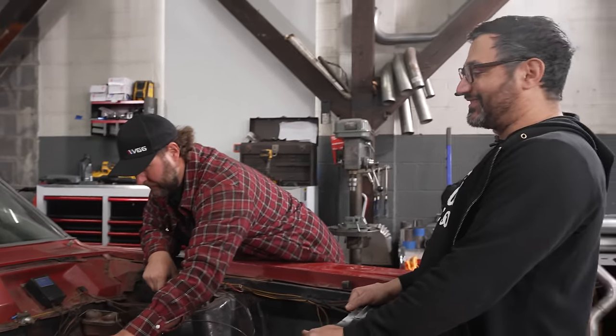Don't do it. Somebody get a tape measure and let's do this thing. This is the 80s, so it's probably jacked up. Yeah. Probably have some heat here. 68 and 3/4 inches. The center of the U-joint, so right on that flange. 60 here. And a quarter. Or 61 and 1/4. Perfect.